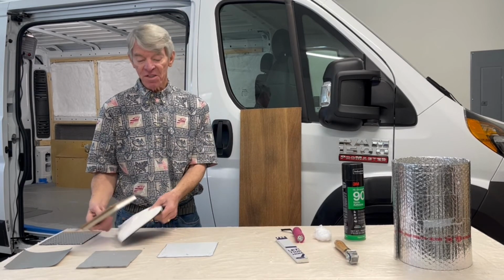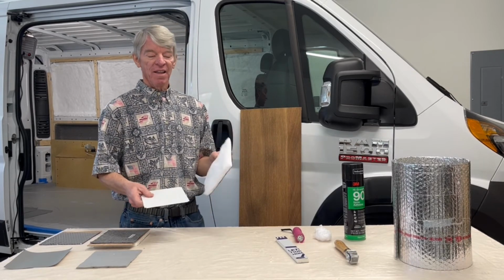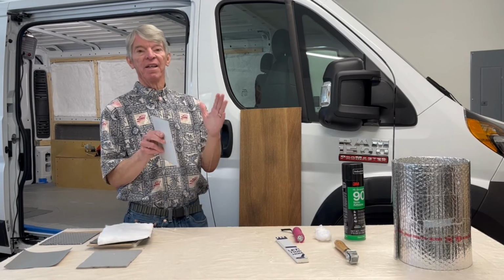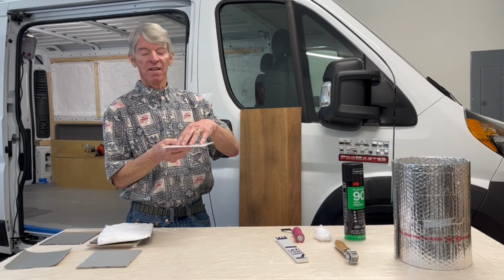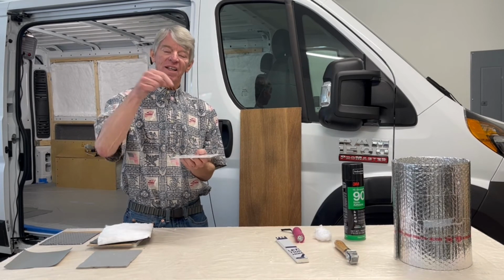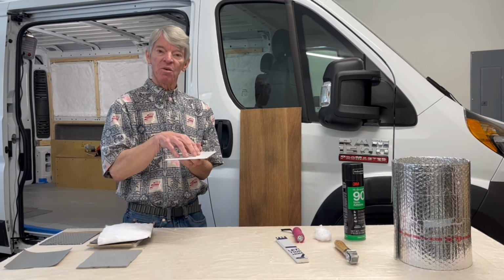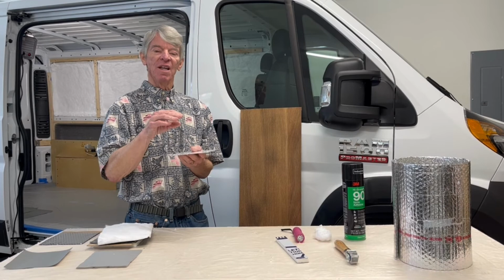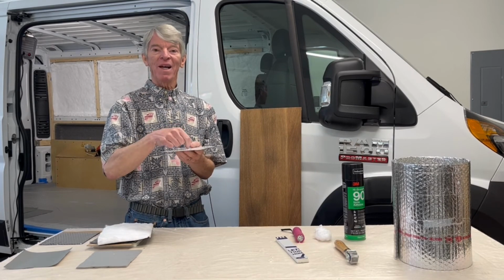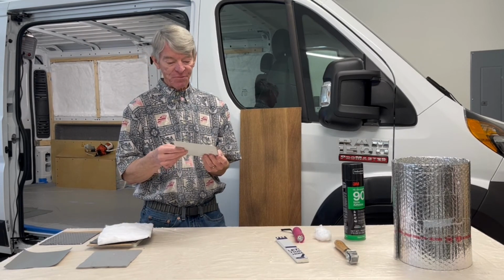Now, from this discussion, you can also appreciate that with an air gap between the panel and the surface of the van, the white paint on the top of the surface of the van can reflect the infrared that's generated from those panels back away from the van. So in addition to not conducting heat, that air gap allows us to reflect the heat back out of the van into the panels, where it gets dissipated into the atmosphere.